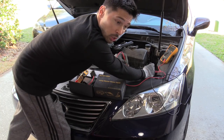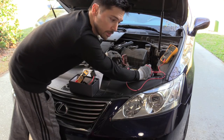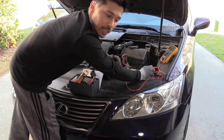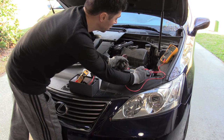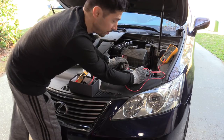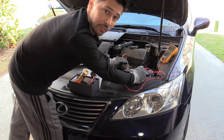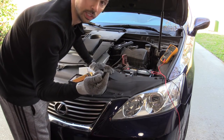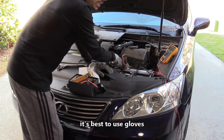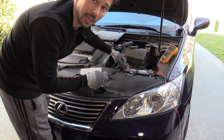If your battery is very low you'll read below 12 volts and have a hard time starting your car. When the car is running and it's below 13 volts, something's wrong — the alternator may not be charging your battery fully. Make sure you read the voltage on the connector, not directly on the battery, because loose connections or corrosion on the terminals can influence the voltage getting to your car. Use a wire brush to clean the contact, then tighten it up and see if the car starts.